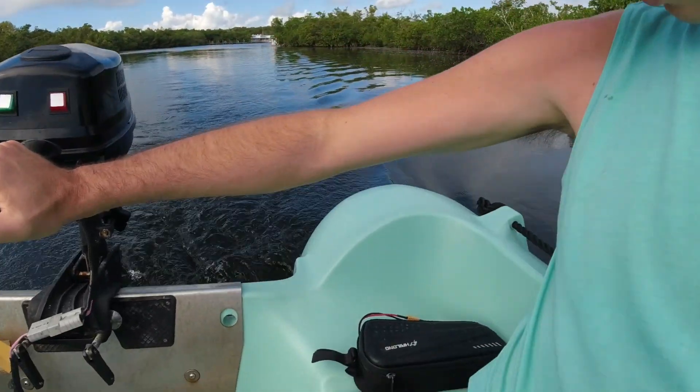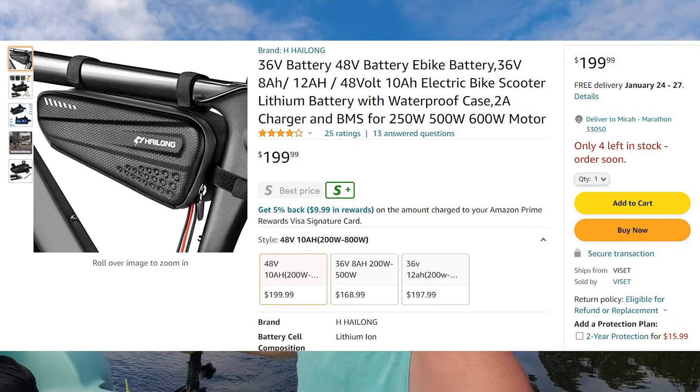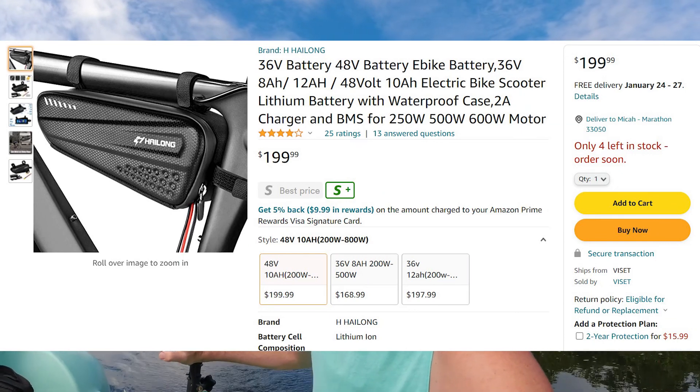We've been using a really small battery — it's lithium-ion, made for a bicycle, and it's half a kilowatt. We get about four miles on that going at a moderate speed. It's fine for up to 1,000 watts, so the battery works fine up to 1,000 watts. After that the BMS will kick out. Since this is a 2,000 watt motor, I can't run it at full — maybe at full for about five or ten seconds, but not very long. That's a problem more with the battery than the motor.